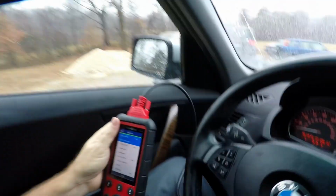The whining noise, we're gonna have to do a little research on it. And if we can't figure anything out by that, we're going to have to get it jacked up in the air on 4 jack stands and run it. And hopefully we can tell where that noise is coming from. That noise is not engine speed related, it is speed related only. You can pop it up in neutral when you're going. It doesn't change the pitch of that whine. That doesn't sound good.